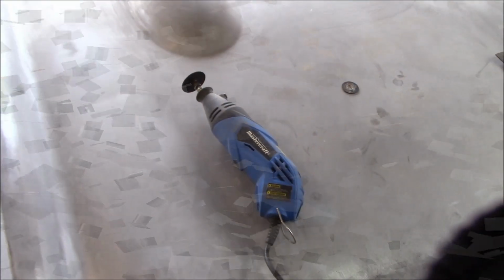Here we go. Alright guys, we got the Dremel out, the thin blade on it, and we're just going to zip this from this line all the way down to the nose, and we'll split that apart. We'll make a few measurements, put it back on the car, adjust it, then weld up the gap. We'll probably have to put a little piece of metal in there, down the bottom at least, and then we'll weld her back up and grind her down, see how we did.